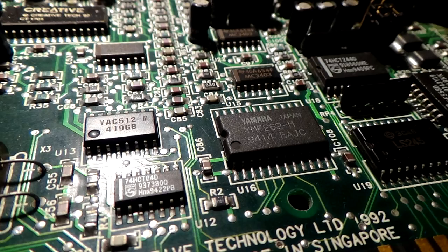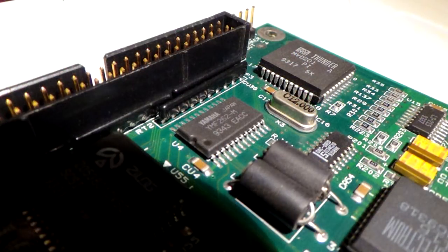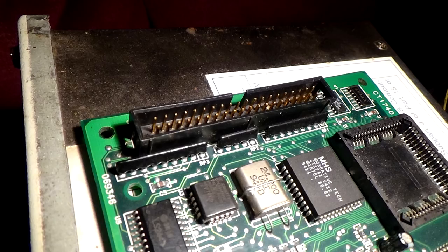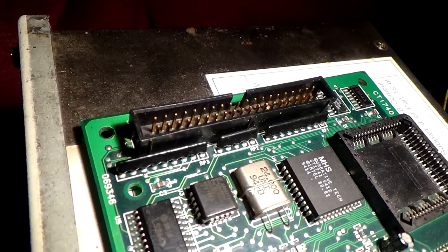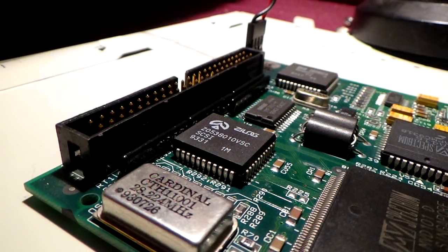They also both offer a Yamaha FM synthesizer chip, a real YMF262, and both of them provide an interface for a CD-ROM drive, and were sometimes sold in multimedia kits with a drive included. The differences start to become more clear here, as it appears Creative favoured the Panasonic MKE interface, whereas MediaVision usually provided SCSI. Both cards were available with a variety of different interfaces if you wanted something different. These just seem to be the most common.